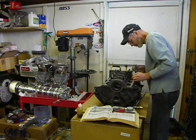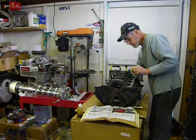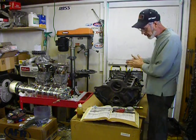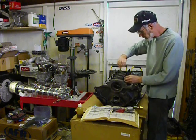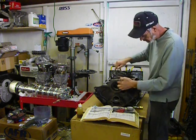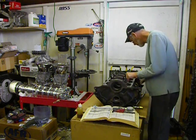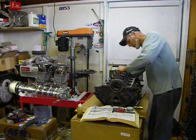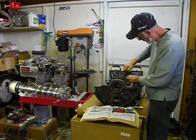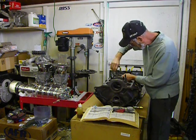It's not critical, but when you put a crankshaft in, we give the crank a bit of a bang with the hammer driving this way and then this way to center the thrust cap. The Chevy, of course, is in the rear. The Ford is in the front — or rather not in front but in the middle. A lot of motors put them in the middle.